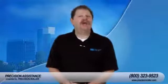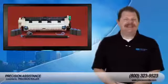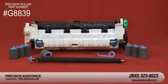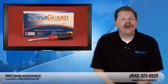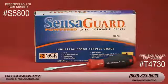While this is a great recommendation, the time to install a new maintenance kit will vary depending on your printing conditions. The HP LaserJet 4250 maintenance kit includes one fuser, one transfer roller, one plastic transfer roller tool, one pickup roller, and six rollers for all other trays. Please note, depending on which optional trays you have, you may not need all of the rollers. We are only going to use two of the rollers for this installation. The tools required are a pair of latex gloves and a standard screwdriver.